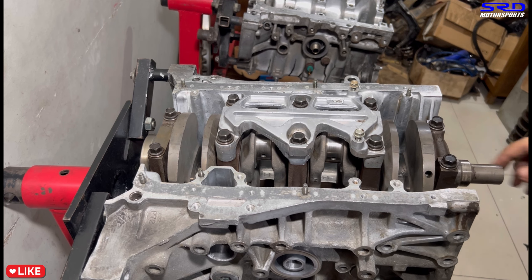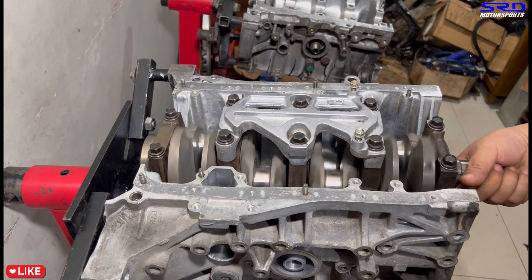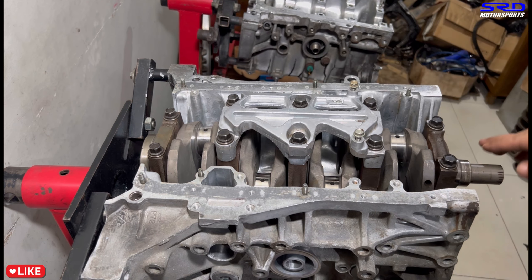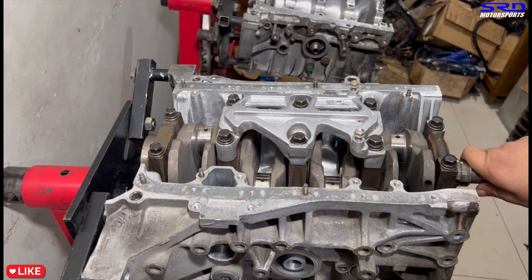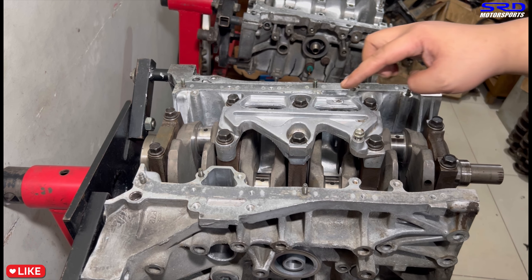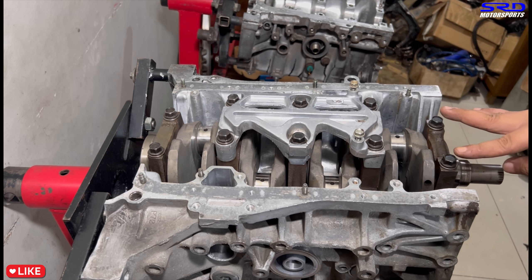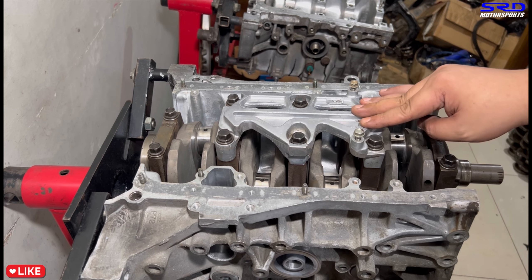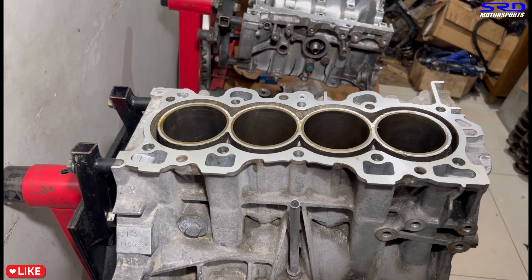Let's turn this now — oh man, that turns really light and really good! This is how we like it; it means it's going to be turning freely so the pistons are free to make all their power. Cap one and five is torqued like a B20 because a B16 and B20 don't have the main girdle. The center three mains are lower at 49 because the aluminum main girdle expands when warm. If you torque those at 56 at operating temperature it becomes too tight. The B20 and B16 mains are at 56 because they don't have the girdle, whereas the B18 Type R does.